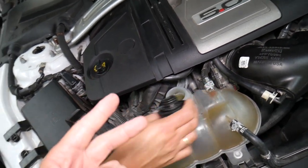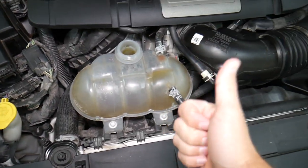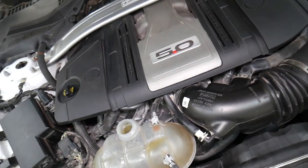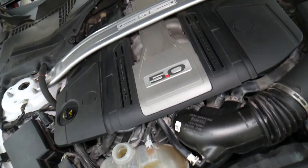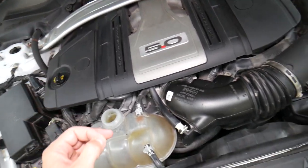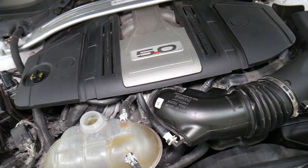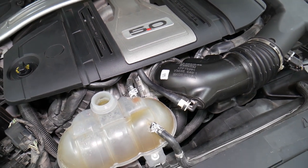Number two: if you recently did any work on the cooling system — such as thermostat replacement, water pump replacement, radiator, or radiator hose — anything that requires draining the coolant, and you just added coolant and started driving, that could be your problem. You may end up having an air pocket in your engine, which will prevent coolant from flowing from the radiator to the engine, causing overheating and pressure. Always bleed the cooling system after draining and adding new coolant. There are multiple videos that will teach you how to bleed it — it's not very complicated, but do it on time, otherwise you can destroy your engine.